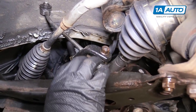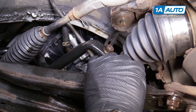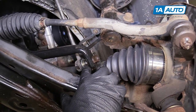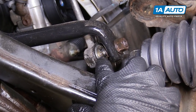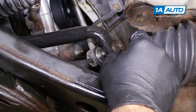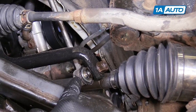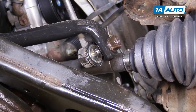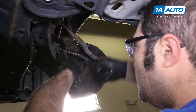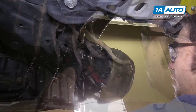I've actually gone in here because these sway bar links get seized so easily — I cut the boot away, the rubber boot, so that I can get locking pliers in here and get a better grip on it. And it's kind of working — by holding it, I'm able to turn the nut out. Worst case, if I get it loose enough and it just keeps spinning, I will take a saw and cut it right here. I'm going to keep trying with the locking pliers. Got it.